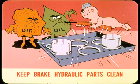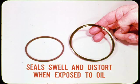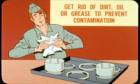And here's where I make my speech about the importance of keeping brake hydraulic parts clean. Any foreign particles in the system can cause scoring of parts and may also interfere with control valve operation. And when handling parts, remember that the slightest trace of oil will destroy seals. You see, hydraulic system seals work well with brake fluid, but will swell and distort when exposed to oil or petroleum-based cleaning solvents. Try leaving a piston seal in a pan of oil for a day or so, and you'll see what I mean. Before assembling any hydraulic parts, the careful technician will clean his hands to get rid of dirt, oil, or grease, which can cause contamination. Generally speaking, all seals, pistons, and other similar parts should be lubricated with clean brake fluid before assembly.